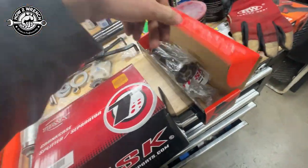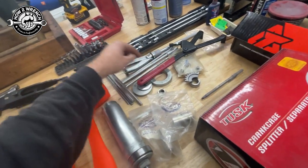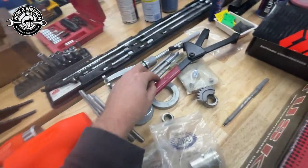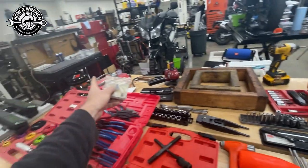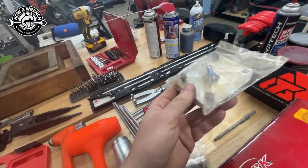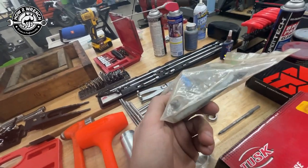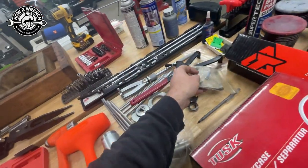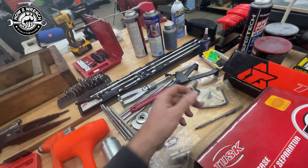Kawasaki has a different adapter for the crankshaft puller. I've also got good old-fashioned T-handles: number two and three Phillips, and eight and ten millimeter. You're going to use those like crazy. I also have a mighty-vac manifold I made for an RM85 — we'll do the same for this KX. This lets us pressurize the motor and pull a vacuum to prove that the crank seals hold, the crankcase gasket holds, and the head gasket holds. That's what it's for.